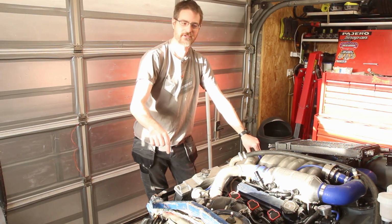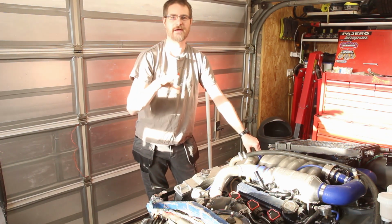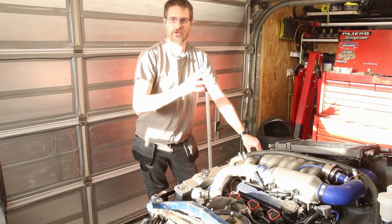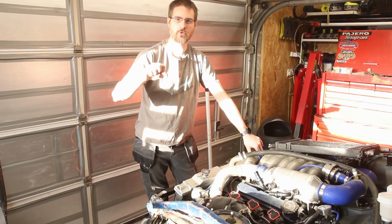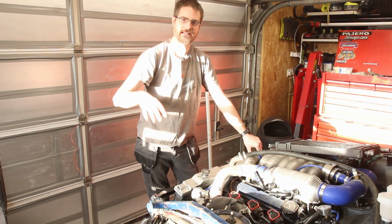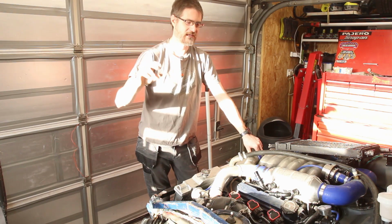So I also need to figure out how I'm going to get the water out of the reservoir into the pump, then into the Chargecooler, then the radiator, then back to the reservoir, or maybe some other direction, but probably that way so that the water that's in the reservoir will just go straight down via gravity into the pump for priming and bleeding.